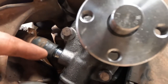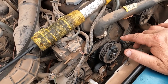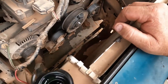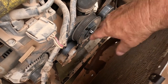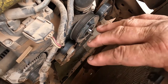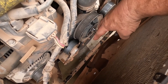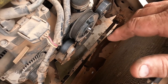I'll put that clamp on the hose and install the lower hose. I got it all back together. If you have the opportunity, go ahead and put coolant in before you put the belt and shroud back on — if you have a leak, you can find it real easy. I've got a bolt in here on the pulley to keep it aligned where it needs to be while I put the belt back on. Then I'll slide the fan and shroud in, remove that bolt, slide the fan on, and put the bolts in. That way I don't have to mess with the belt system with the fan in the way — it's a real pain. Do it now while it's easy.